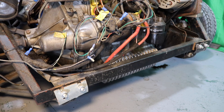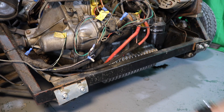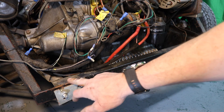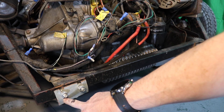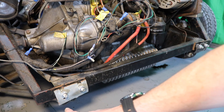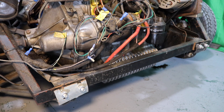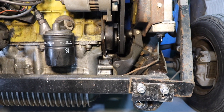Now I've got the front end off the car. These are the brackets I made — they're a little bit rough. I did intend to make something a bit better but I was getting pressed for time coming up to the IMM. These brackets fix on to where the front brace bars mount, and there's a hole drilled there which has got an M8 nut welded to the back of it, which goes through the hole on the front of the fibreglass, with a couple of washers to pack it out. It's been on 18 months, probably five or six thousand miles, and it's been fine. I'm holding the camera by hand for this bit so you'll have to excuse the shakiness.